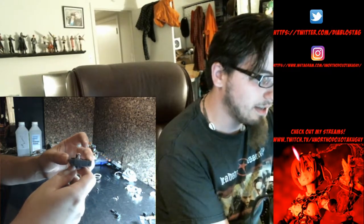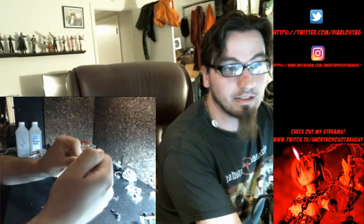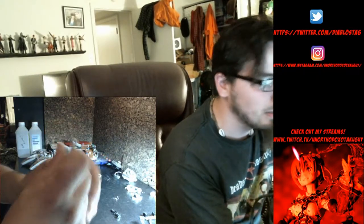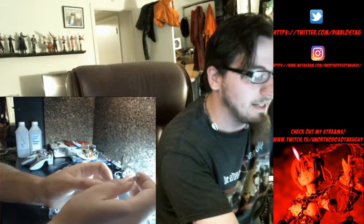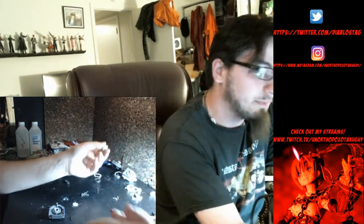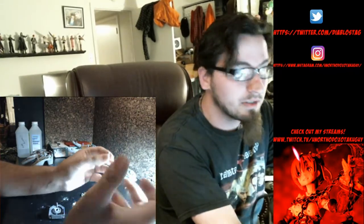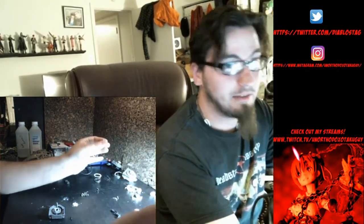So now the control stick can come out, and this thing is quite worn. It's reusable. I'm not going to lie, it's probably a little bit reusable, but the best effect is to get a new one, because this little nub here is actually what's grinding away in the bowl. So it's not 100% reusable, but it is. For how cheap these are, literally the sticks are $1, I would recommend replacing them. But there might be some purists who want the gray stick because the replacement ones are clear. That's up to you. I'd rather have a functional stick in an authentic controller that's clear rather than gray. The clear ones, I like them because I know that one has been rebuilt. That's why I like them. So I don't have a problem with it.